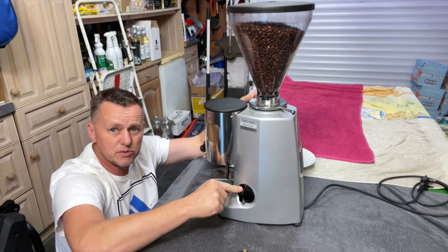The only thing is this switch - the diameter on this is slightly bigger than the hole we've got in the machine, so we're going to have to drill that out. We do need to just put a cup in there or something to catch any little burrs that are going to fall inside - we don't want to get any in the motor. So let's get this sorted and make sure we do this properly. I've got a drill bit here.